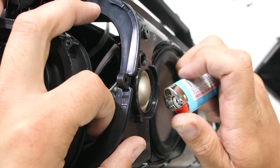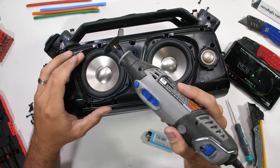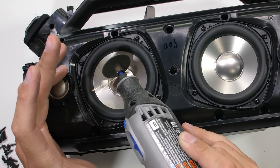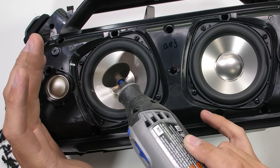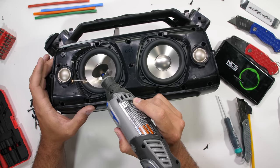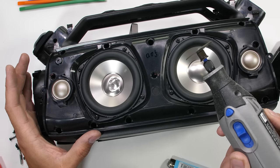I do have doubts about the main speakers, with Soundcore saying they're constructed of premium titanium — but there are ways to find out for sure. A cutoff disc can tell us quite a bit: if the inner portion is made of plastic, it'll just melt; if it's made of aluminum, it won't spark at all; and if it's made of steel, it'll spark with an orange glow. But if it really is titanium — just like we saw when I made my wedding ring — it'll spark with white sparks as we cut into it. And as we can see, it is indeed metal and it is indeed sparking with white hot titanium. Titanium is a super premium material for speakers — non-corrosive and a bit more expensive, but also extremely stiff and extremely lightweight, so the dome can more precisely vibrate, starting and stopping easier to make more accurate sounds. It's also a better thermal conductor and can dissipate heat buildup from the speaker itself better than plastic can. It's definitely a thin layer of titanium, but that's all we need.